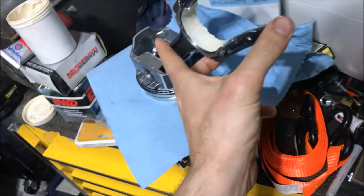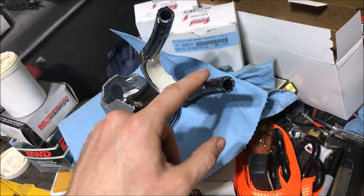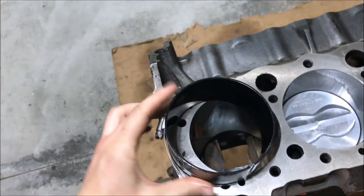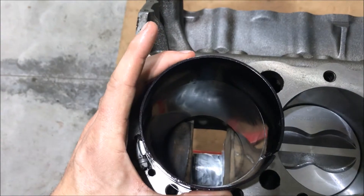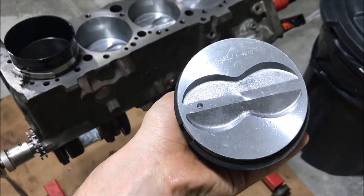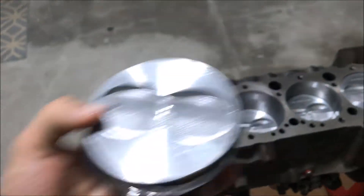The hose is almost a little bit big, which is perfect, because as you're going down onto the crank it guides it right in — it's a soft surface guiding it versus the bare bolts, so it guides right into place. I got this ring compressor from Summit Racing, for 4 to 4.06 inches, basically for a small block Chevy 350. Line that up under there, grab your piston. Your piston should have a dot on it — try to point that dot toward the front. I did that on the other three cylinders also.